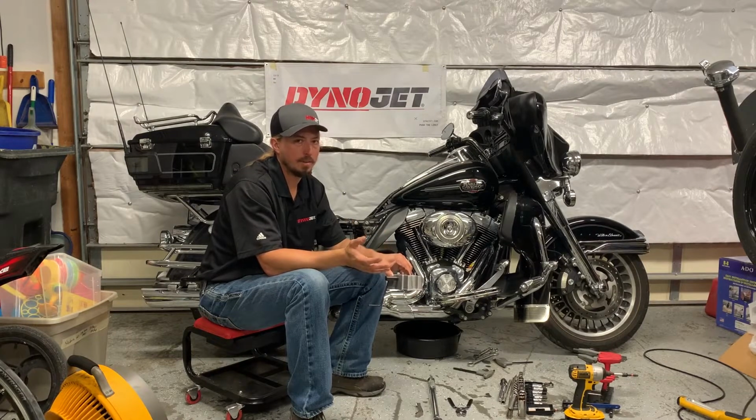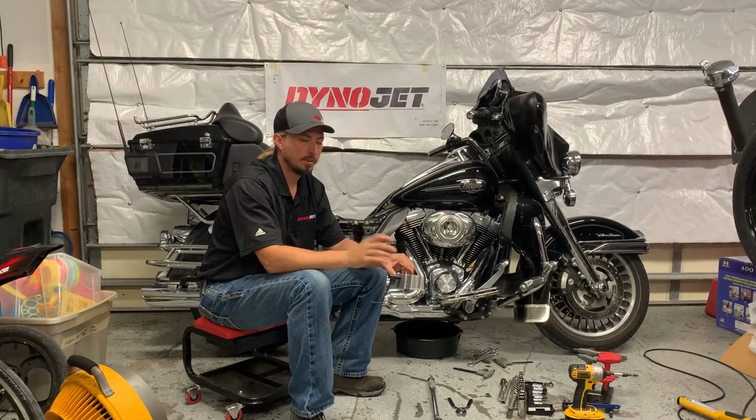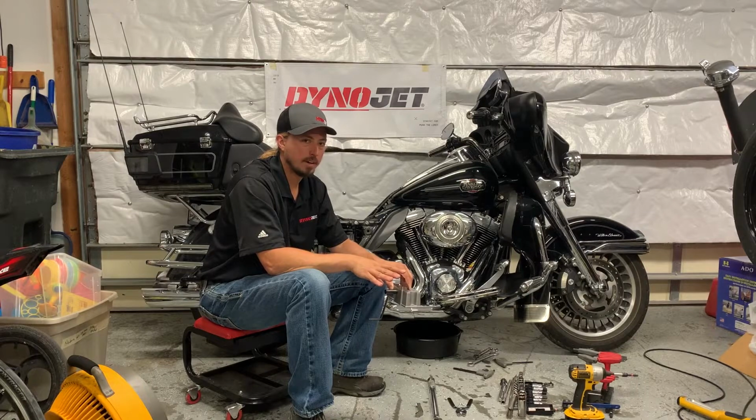But one of the steps that you need to do before assembly is to put the piston rings in the cylinder bores and check what that clearance is. And we'll talk about that when we get to it. But these are some of the tools that you're going to need. If I come across anything else during the video, I'll make sure to point that out.